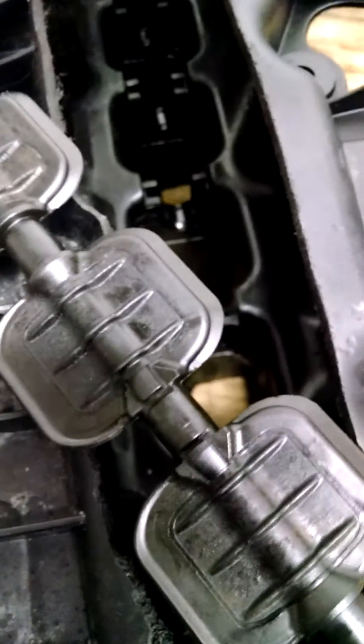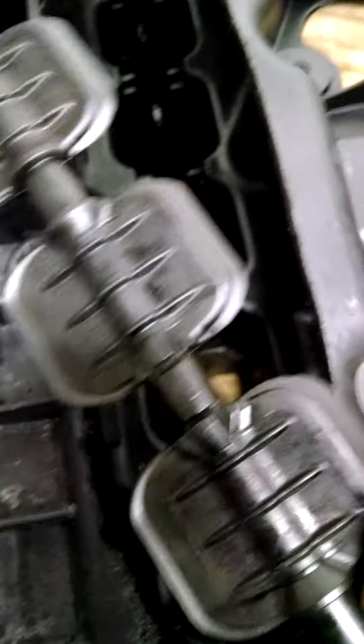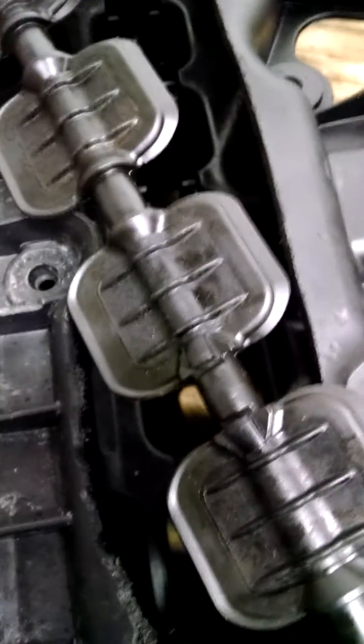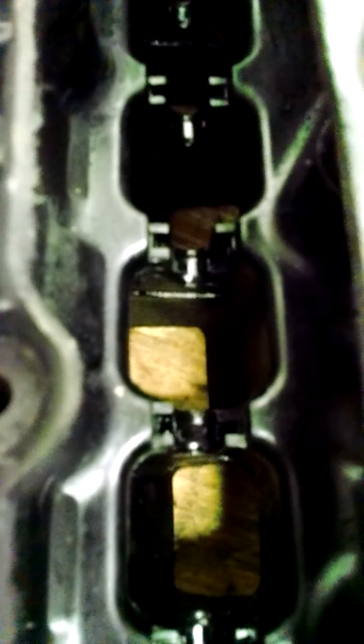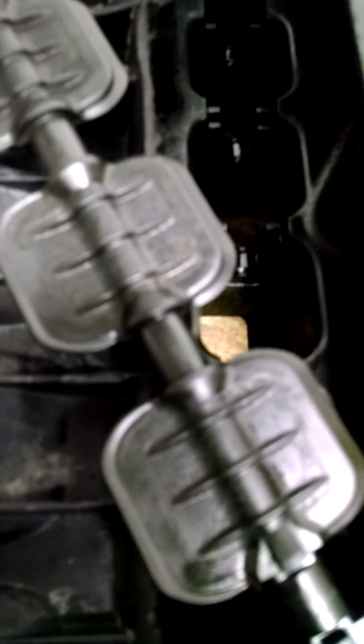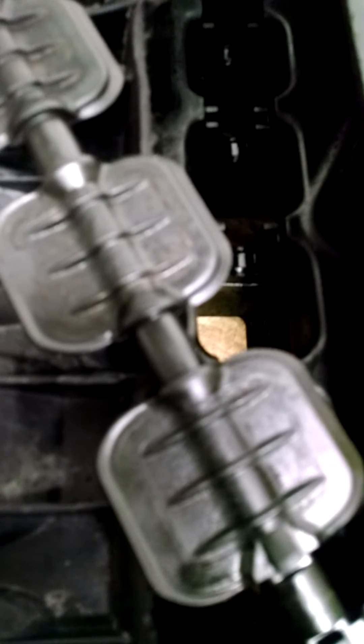These are rubber. These are like the journals — in between the flapper valves, they're actually soft rubber and they sit in a cradle, which is hard plastic inside the intake manifold. The top of the cradle is covered with a hard plastic cap. They're not removable. I chiseled these things off just to show you how this thing is put together. I didn't see any appreciable amount of carbon in there that was causing the sticking of the shaft, not allowing it to turn.